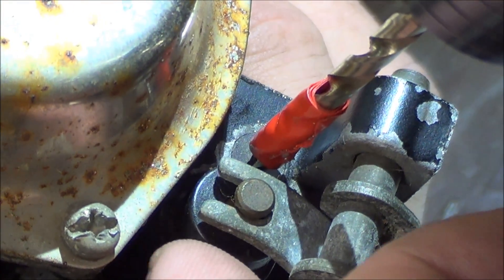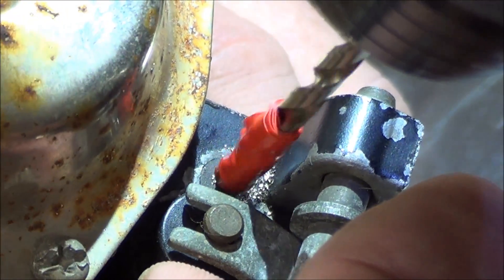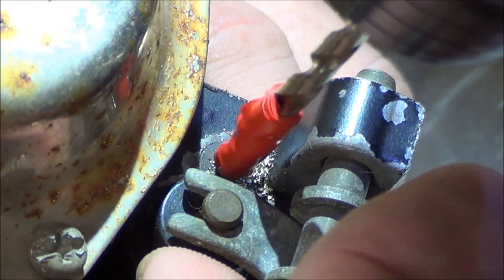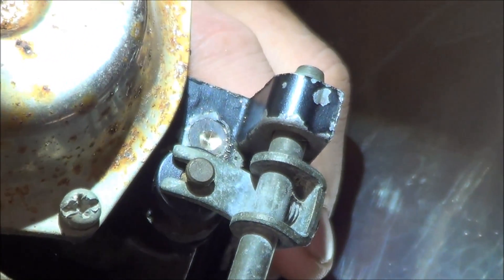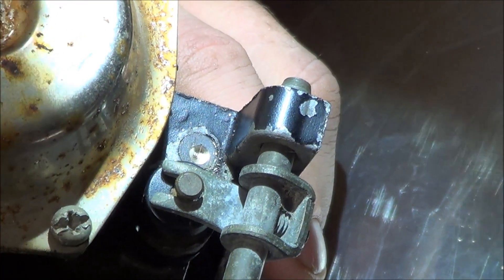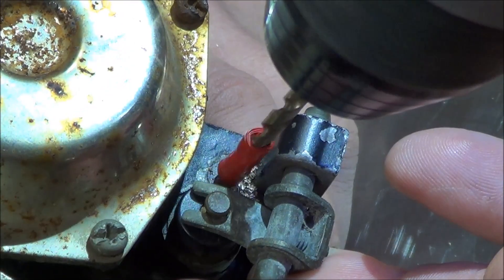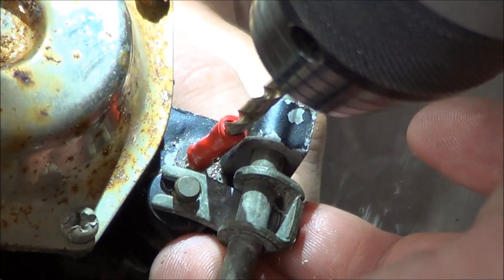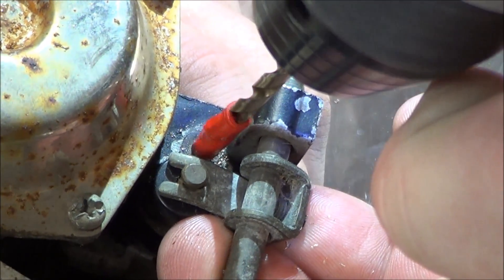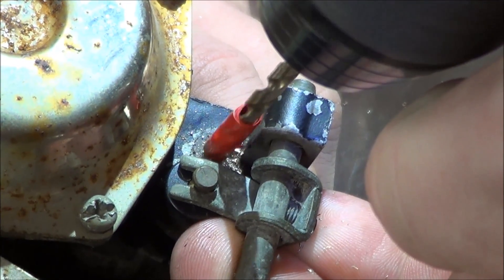He's looking really nice and centered. He stops to blow the chips out of the way and check his work — stopping and checking is a good idea. He's trying to make sure he doesn't pop all the way through, just catch the plug. A lot of times, as soon as the drill bit pops through, it will actually catch the Welch plug and break it free anyway, and the Welch plug will stick to the drill bit. That's super desirable. He's also keeping the drill bit nice at 90 degrees — rocking forward and back would oblong that hole. Notice all the guys have safety glasses on.